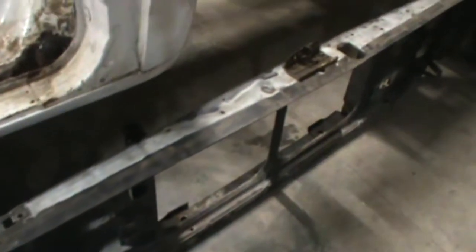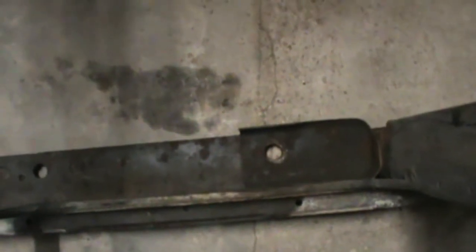Quick update: we got the front core support off. I'll show you it sitting down here on the floor — it wasn't too terribly hard to remove. You've got some bolts up underneath the frame — small ones, I think maybe five-sixteenths, maybe a little bigger — but they have those little clip-type holders. I highly recommend you soak those down in penetrating oil; I had to get the Sawzall out a couple of times. On where your bushings go for your grille support, that was an 11-sixteenths inch nut and a half-inch head bolt, at least on my truck.